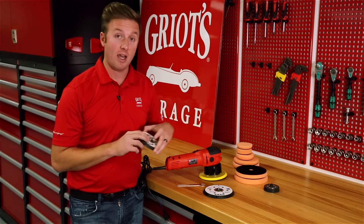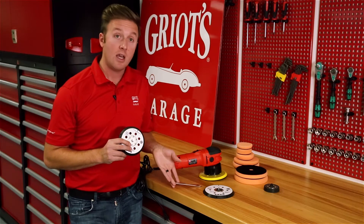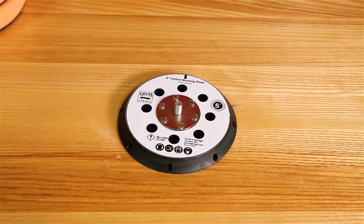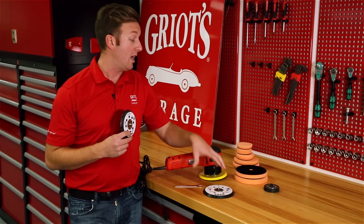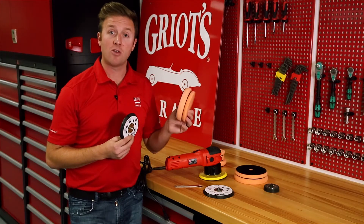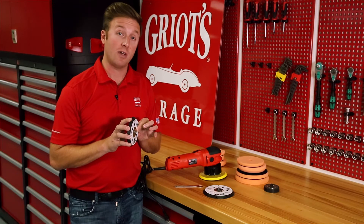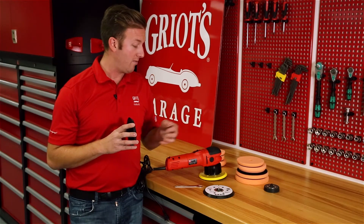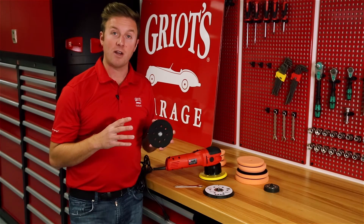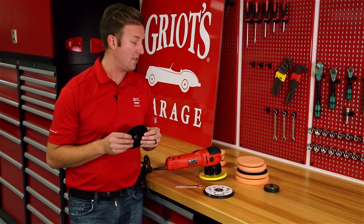After that, we can go to a five inch backing plate. Now these all adapt the exact same way — you have a very thin wrench that comes with your six inch machine out of the box and you simply affix it to the counterbalance in the machine and spin the backing plate off. Now this five inch pad is going to have the same ventilation standards as our high performance six inch backing plates and it will accommodate both the five inch boss pads and one inch thick pads. The smaller footprint of a five inch backing plate as opposed to a six inch backing plate is going to result in more aggressive and better performance. You are also going to get a little bit more maneuverability since the only thing you've changed is really the footprint or surface contact of that smaller backing plate.